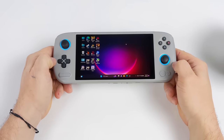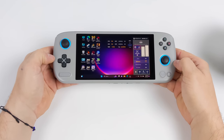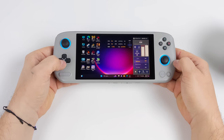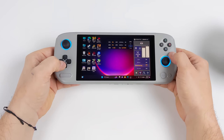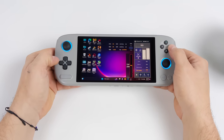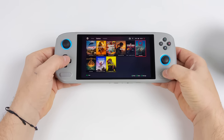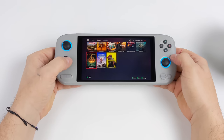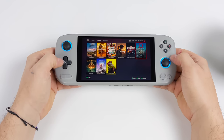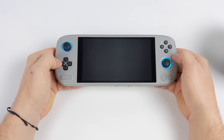Out of the box this is running Windows 11, but Aya Neo is working on Aya OS, which is based on Linux. It's going to be an awesome Linux distro and as soon as I can get my hands on it we'll be testing it on a few of their devices. With Windows we do have access to their Aya Space, which comes in really handy. From here we've got a lot of tweaking and tuning we can do with the APU — like changing the TDP. We've got a few different presets and this will go up to 28 watts. The built-in cooler is rated for 28 watts on the 6800U and it'll definitely handle it. Along with Aya Space we've also got their game launcher, which scrapes metadata and automatically scans your games. With it we can set up a per-game configuration to change the TDP as soon as we start a game.